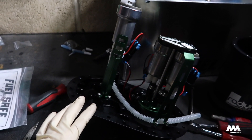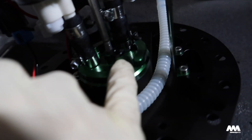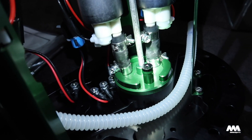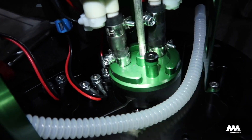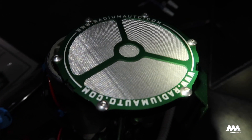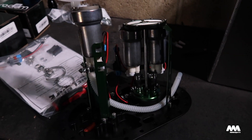This part of the job is on hold for now. I can show you how this thing works though: these pumps mount in here and you can mount up to three pumps - one, two, and there's a port for a third that they give you a little block-off plug for. The pumps are Walbro pumps that key right into this cool little bracket, and it has a little strainer filter that bolts on the bottom that's replaceable. Pretty trick.